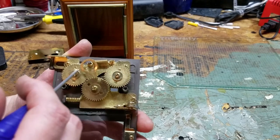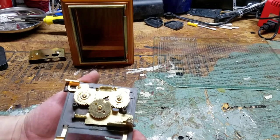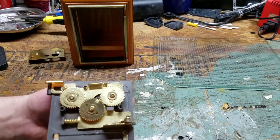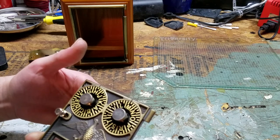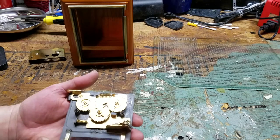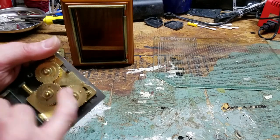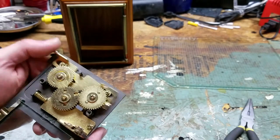The way to fix it is just to reposition this piece over here, set the gears up accordingly, and tighten everything down. To make things a little easier, we will remove this spring. It does lock everything in place so these gears cannot move — which is fine if we're on the right combination, but right now it's at H and almost M plus one. So we'll undo the spring and adjust it. To remove it, you just take a needle nose and pull this end off right here — you just pull it off and it pops off, fairly simple. That allows you to push this piece, you've got the locking pin.